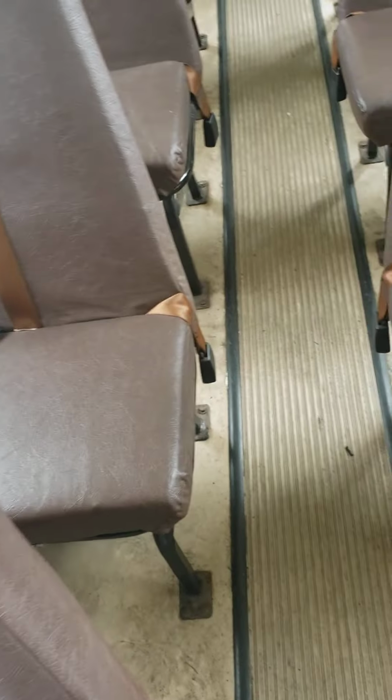There's the muffler, not cracked, not broken. Muffler is secure. All the lug nuts and bolts are present. I do not see any illegal welds. I do not see any illegal holes. And I do not see any leaks coming from my muffler. Muffler secure. I see all of my hoses and all of my wires. I do not hear any leaks coming from any of my hoses. And my wires are not ripped, they're not frayed, no cut, no damages.